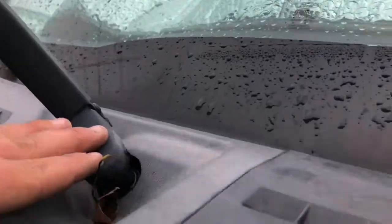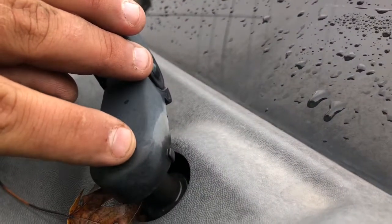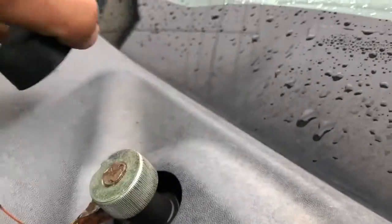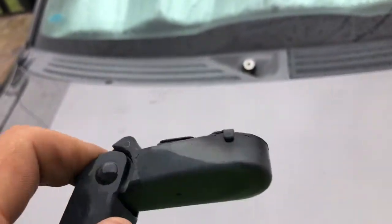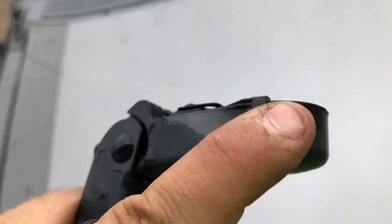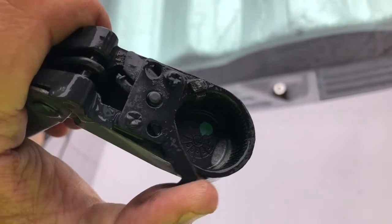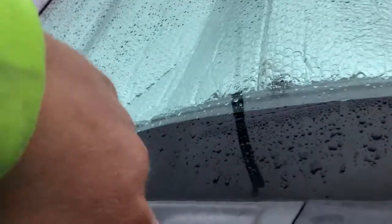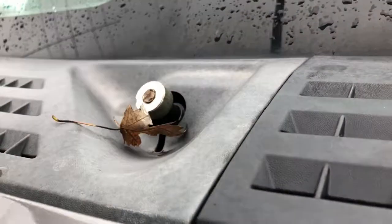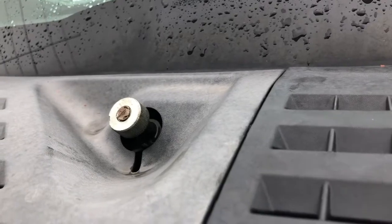The first thing you have to do is take off the windshield wipers. There's a little pin on this side of the windshield wiper - you just push that up and they pop right off. They're very easy. That pin right there, all you do is take your finger and slide it up and that just loosens it so it's able to get off of that lip right there.